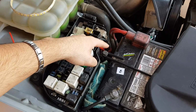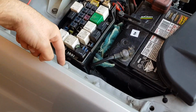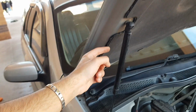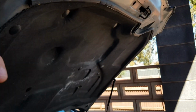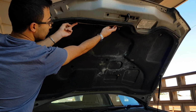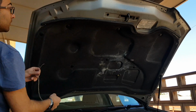We're going to run a positive down along and actually connect it to one side of the fuse holder, the other side to the switch, and then from the switch we're going to run the cabling along and tuck it away out of sight under the guard, all the way along, starting up the bonnet side, underneath the bonnet liner. Keep going with that positive cable all the way up until our location where we want to have our LED strip. And just to show you all, this is the loose area that I'd planned to put the LED strip, as that was the most flattest part of the top of the bonnet. And once I visualized exactly where I was going to put the LED, I started with the wiring.